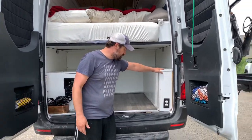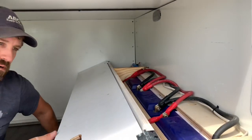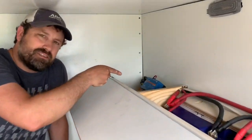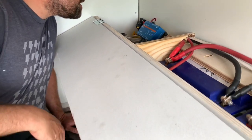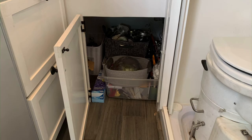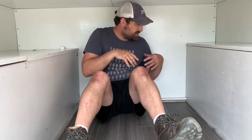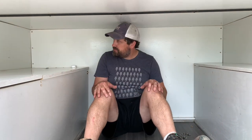Back here there's an external shower and hose for watering your flowers. On this side is where all the electrical is — there's an external outlet here. Flipping open the electrical compartment, we've got the six Battle Born 100 amp hour batteries, the Cerbo GX control unit for the touchscreen, the solar controller, and fuses. Underneath is the fuse panel and some storage. There's also a whole section about 22 inches long for gear storage, and the Victron 3000-watt inverter and fuse box are in there as well.